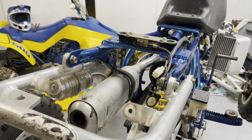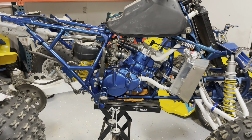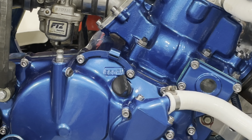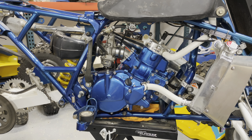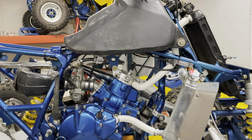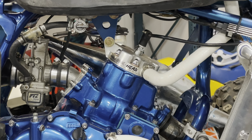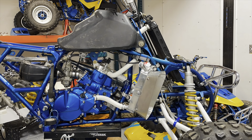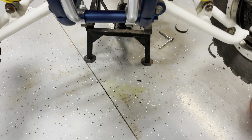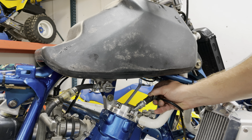The silencer situation is figured out and the reservoir is mounted nice and tight. I've got spark, and now I need motor oil and antifreeze. 250 Quad Racers take 900 milliliters of oil — you can see it on the side of the clutch cover. I recommend an 80-weight Belray Gear Saver oil for the transmission. I'm adding the antifreeze now. On the LT 500R project there was a weep bolt on top of the head; the 250 has that too, except on aftermarket heads like this cool head I'm running. I'm going to check for spark — switch is on, I'll ground out the spark plug and kick it over.